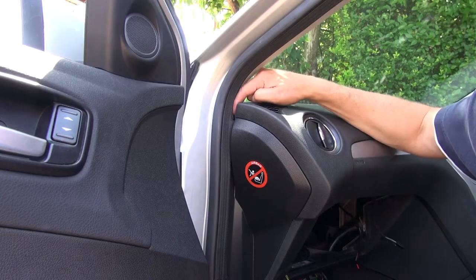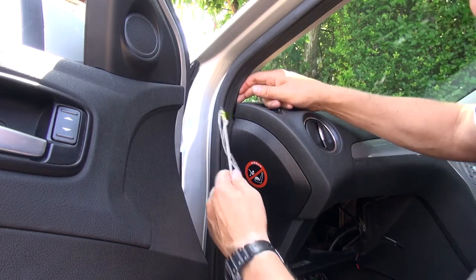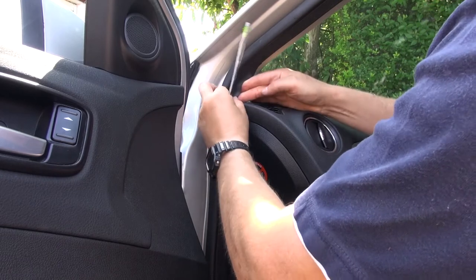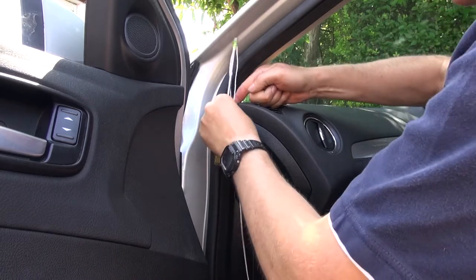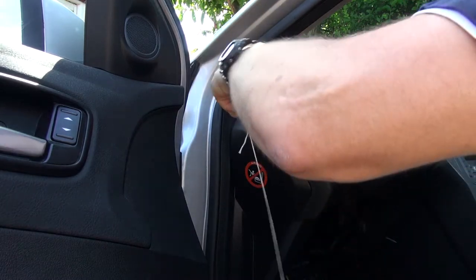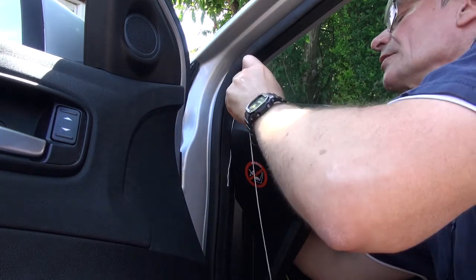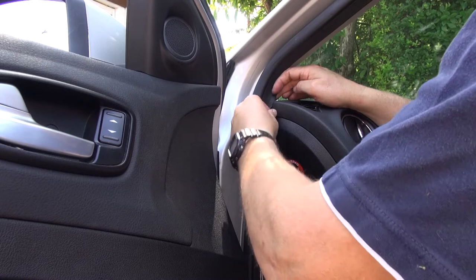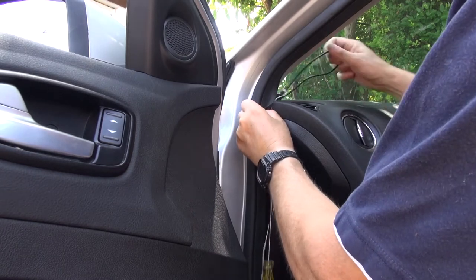Getting down this hole is proving a little tricky with this piece of metal in there, but I know this cover runs all the way down. So I'm going to use a piece of string taped onto a screwdriver to create a drawstring to pull up the wire. I'll pull this rubber out of the way, get in behind the cover, push down, and feel inside — and yes, there she is. There's the cable and there's the end of it.